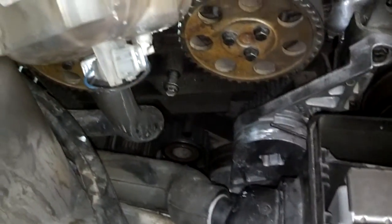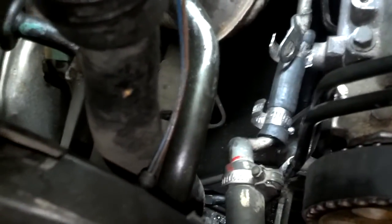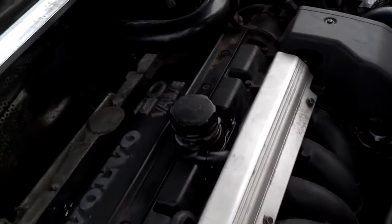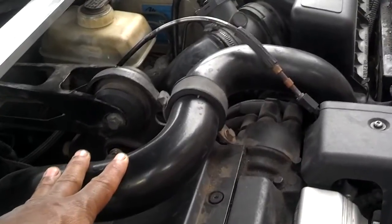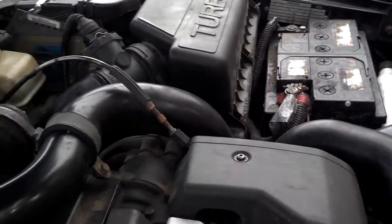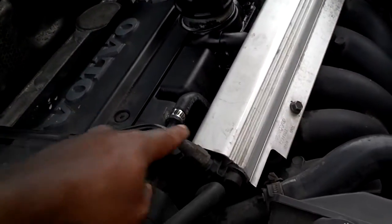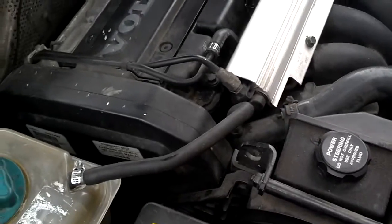I got the vacuum on the front of the manifold, got the fuel rail installed, got the water bottle hooked up with the coolant lines connected on the back. Next I'm going to plug in the water bottle and hook up my radiator hose. I also put the bolt in the oil pan and put the bracket on the back of the fuel lines. Finishing up the install, you're going to install your upper motor mount, put your intake tubing in place, make sure all of your air box and battery and everything is hooked up and connected, and make sure your fuel line is tight.